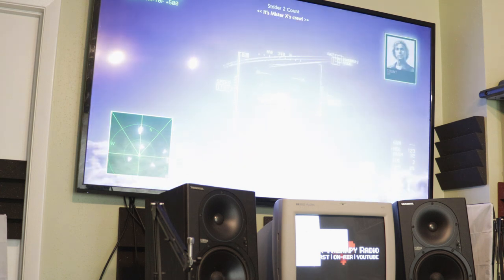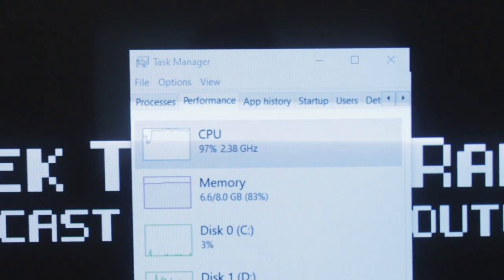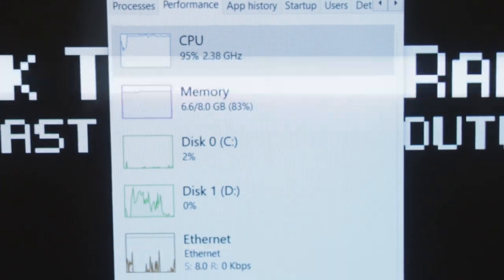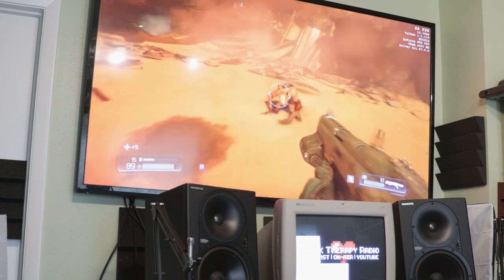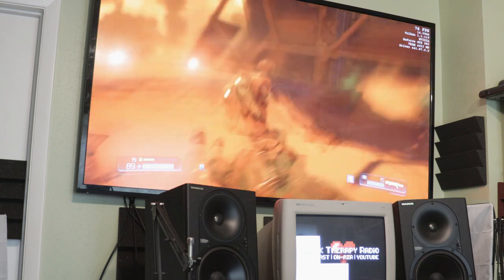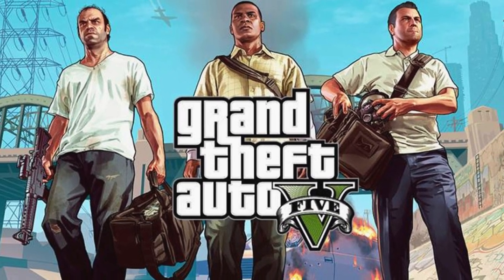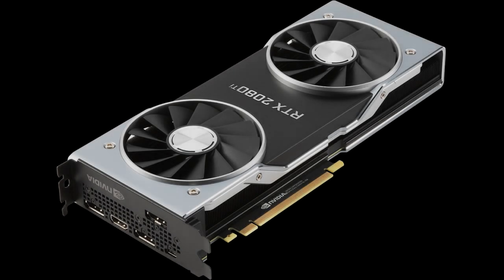There is a good chance somebody may watch this who wasn't even born before 2007. Now I feel old. Before we move on, I need to acknowledge the elephant in the room. The Q6600 was pegged unmercifully between 80 and 100% load in every game I tried. Forget about live streaming gameplay — there's barely enough headroom left over to play a podcast in the background. Given that the 2.4GHz Q6600 screams for mercy in modern games despite surprising performance in many cases, there's no way CPU-intensive games like GTA V would fare well here, regardless of GPU. A Q6600, as surprisingly usable as it is well over a decade later, will cripple an RTX 2080 Ti.